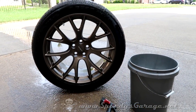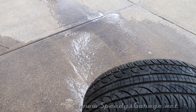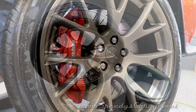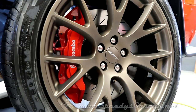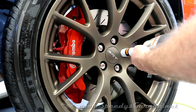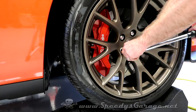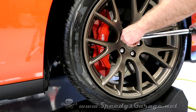While you've got the wheel off, you might as well go ahead and wash it — all that black came off just this one wheel in 100 miles. I went ahead and washed it front and back, and hopefully the new pads will prevent that from happening again. Just remount your tire and always run the lug nuts down by hand, then give them a few taps with the impact on the lowest setting in a star pattern. Finally, lower the car so it's back on its own weight, tighten your lug nuts in a star pattern to 110 foot-pounds.